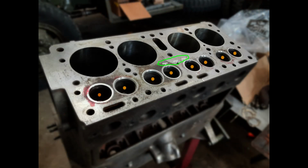In this photo you see the valve seats have been replaced, and this is highlighted with an orange dot. The main purposes for proper valve seating are the following. First, compression gas sealing prevents compressed gaseous bodies and combustion gas from leaking into the manifold. Second, heat transfer releases heat in the valve to the cylinder head. Third, strength holds tight when the valve is mounted. Fourth, wear resistance, hard to wear down under high heat and high load.